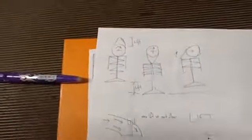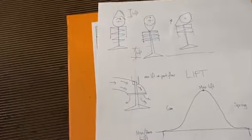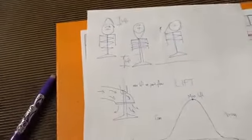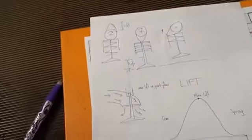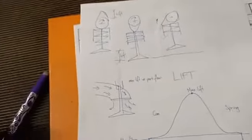So that's the consideration, I guess, when OEM cars are built. They've got a fairly mild sort of profile, and they don't run very firm springs, and the whole thing lasts 200, 300, 400,000 kilometers. That's I guess the pros and cons of having too little or too much lift. The main con is the wear and tear, the valve spring and the mechanical limitations of the setup.